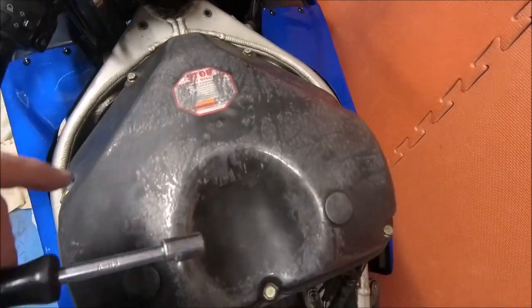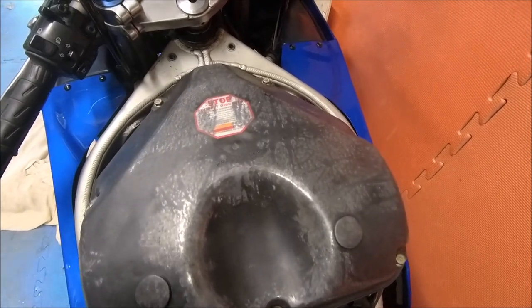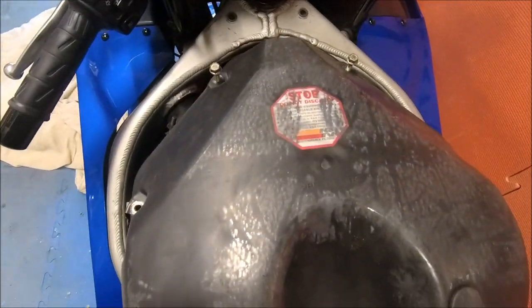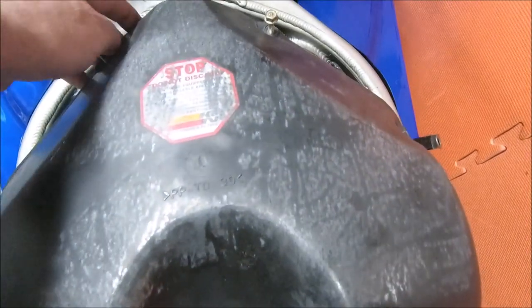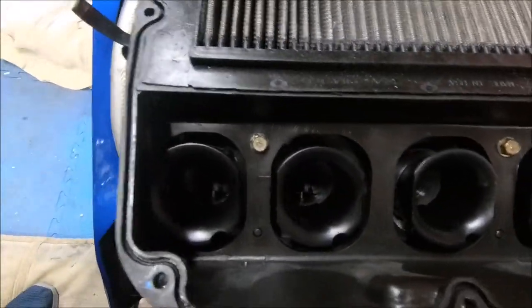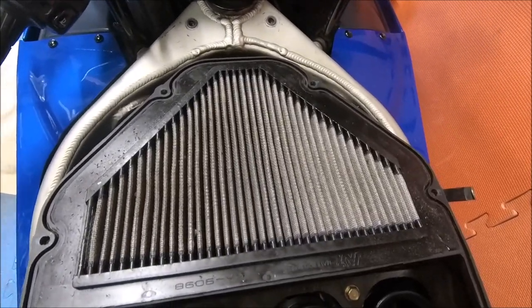While I'm in here I just want to take the cover off and have a look at the filter. It's a K&N one which in theory should last a lifetime — they just need cleaning and a little bit of fogging oil. So all the screws released — just bear in mind you've got a couple of clips, one there mirrored on the other side, so the screws have to come out completely. And there you go — carbs down there and there's the filter. To be fair it's not looking too bad but needs a clean and definitely needs re-oiling. And as you can see in there — bugs aplenty.